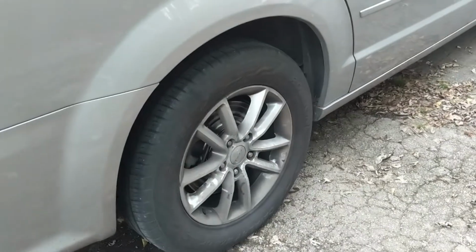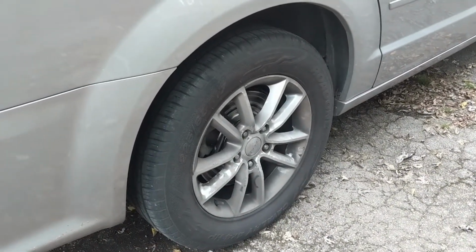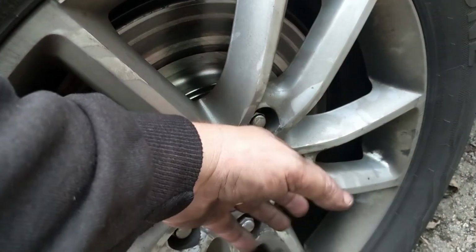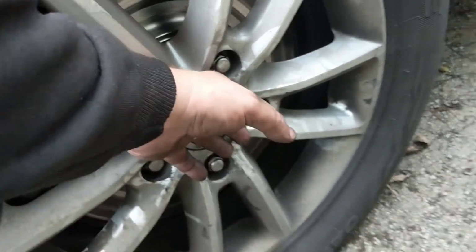And now we are back at the Dandy Ranch after a neighborhood and a highway test drive. And as you can see, well, I don't smell any brake smell, so that's a good sign. And there's no smoke coming off the tire. No smoke and things not being on fire is generally a good sign that you did something okay. And you kind of touch the hub. The hub of the wheel is not hot. So there you go, and I'm going to call that a success.